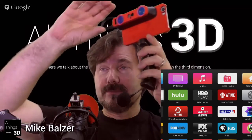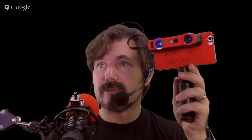The advantage of this system is, let me jump to this screen, there we go, as mentioned before, it uses magnets. They're intense magnets. There have been some concerns from some people, none of the beta testers that I've spoken to, and I did some thorough evaluation the other day about how this affects the camera. In my experience over the last 7-8 months, it has not in any way interfered with the camera functionality or the focus. The iPhone 6 Plus has the optical stabilization, and there's been a video of somebody putting a magnet directly on it. I think the magnet that was used was either damaged or not created properly. So it caused some oscillation.